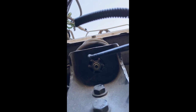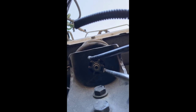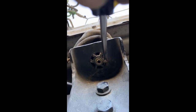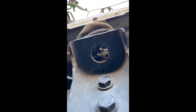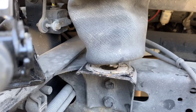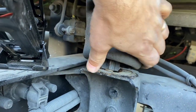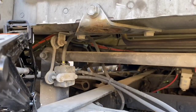There are two different ways you can do this to take the airbag out. The first way is to use a screwdriver, go up to this clip, press the clip in, and then you can just push up on this end. I'm going to press that in — once that's in, I should be able to just push this out of the hole. See how that pushed out of the hole? Let's get back up top.